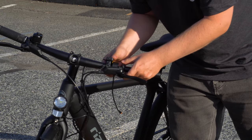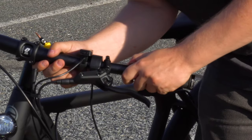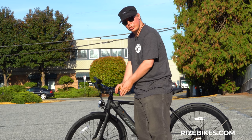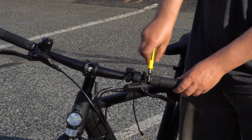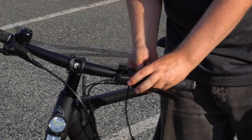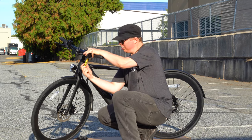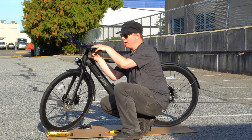Re-slide on your brakes. Once you have everything slid on, I suggest you line up your hand grip right to the end of the edge of the handlebar tube — this is where you're going to have the starting of your realignment. Once it's there, tighten it back on. Tighten up your brakes, tighten up your throttle, and tighten up your control pad.